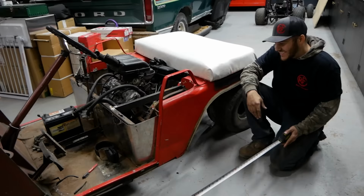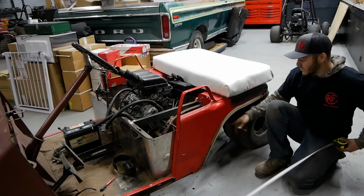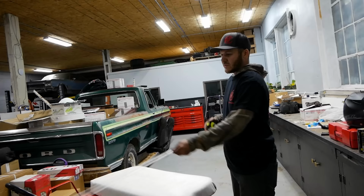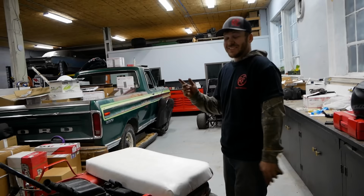I mean, this is going to take us all of a week. I'm going to start the rear hoop because that's super easy. It's literally like one, two, three, four bends. Weld that in. Then we just need to notch a tube up here to tie those two together, put a cross brace through it, slap a roof on that thing, and put the canopy on. It's going to be on tonight. What's the time? Like 11. I can do it.